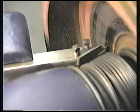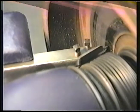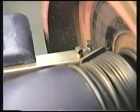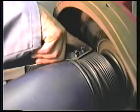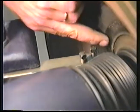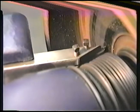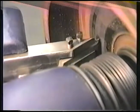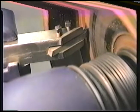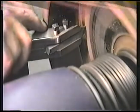So the first thing I will do is just advance the drum this way till it just touches the cutter. Then I'll rotate it in, and you can see it's scribing a line here so that we can trace that. Okay, it makes it all the way across so we can start at the inside, and let's make sure that we have enough cross feed travel. You see it's coming out, and yes, it just makes it to the edge and bumps right here.